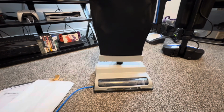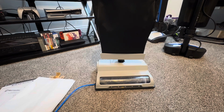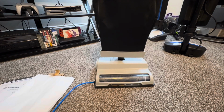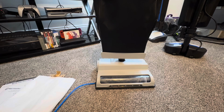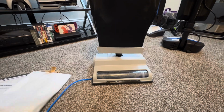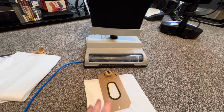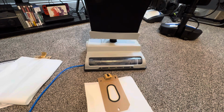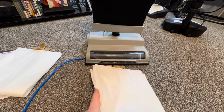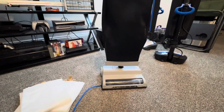You're getting, I think, better performance personally out of the magnesium machines versus the classic XLs in a lot of scenarios. You're getting 2 speeds, you're getting a little bit better brush roll setup, I think, than the plastic that they're using in the current XL20 or XL commercial machines. And the bags, honestly, I never have been a fan of the XL style Oreck bags, so these CC knockoffs are nice, even though they aren't quite as nice as what you'll get with a true CC. But honestly, if you wanted to, you could modify without, I think, too much hassle a CC to fit in there. So overall, very, very interesting.